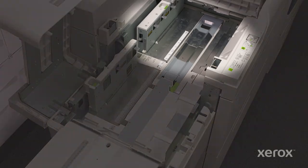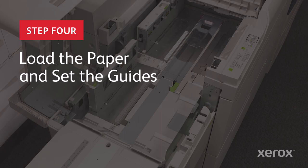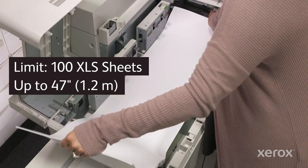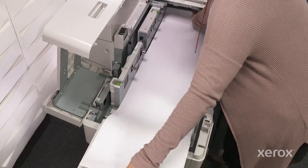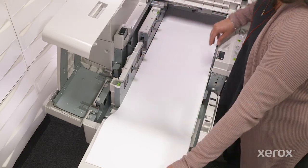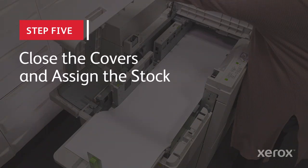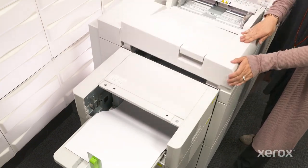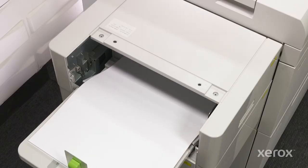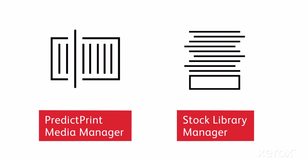Open the long side paper guides and move the magnetic long side paper guide out of the way if necessary. Load up to 100 XLS sheets by lifting the front edge of your paper stack as far as possible into the tray until it is flush with the front. Adjust the long side paper guides, then place the large magnetic rear edge paper guide into position. Close both covers and watch the bottom plate automatically raise the paper stack to a more horizontal position. Program the tray for your specific stock and you're ready for reliable high-volume printing of XLS sheets.